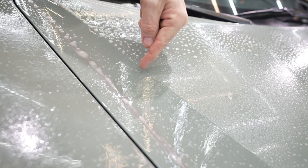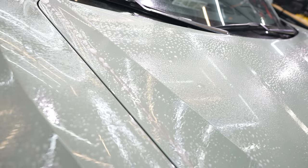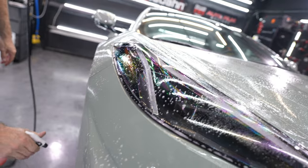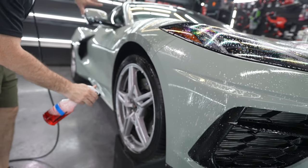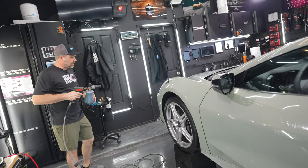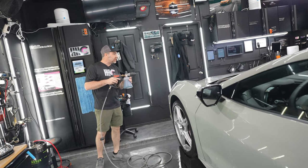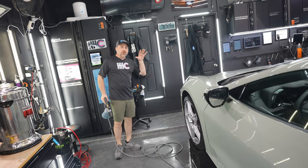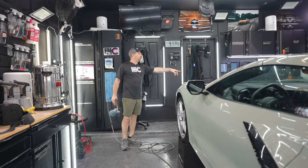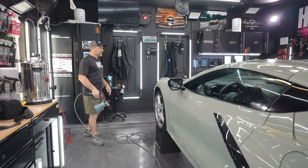You can see it's melting this contamination — I think it's tar — and it's coming off with American Detailer Garage F-Bomb four to one. We're going to do the whole car because it's kind of all over the sides. The next thing we're going to do is hit this with a foam cannon using American Detailer Garage Fury, then wash it off and clay bar. We've already removed the front badge to make a cleaner install on the front bumper, so you'll see us going through that prep process next.